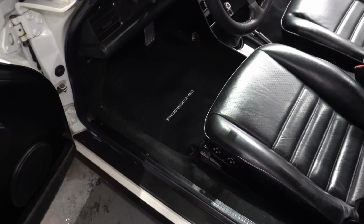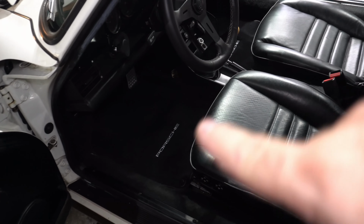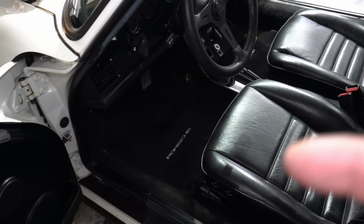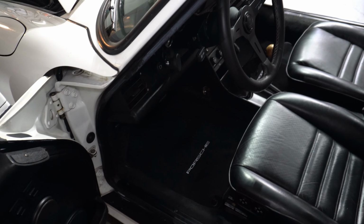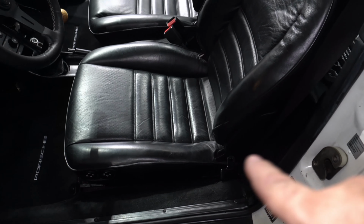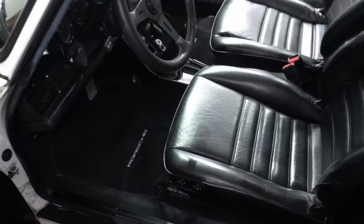And that'll do it. So just to recap, just try and loosen the front two. See if you can get the bracket underneath. Don't let the bottom square bracket or the nut fall out. Loosen the fronts. If you can bend it up a little bit, get the floor bracket in, then tighten it back up. If not, then come back here. There's two in the back, 6 millimeter. Just loosen those maybe a turn, and then see if you can get it in. And that will make the install go from 20 minutes to, because of my foolishness, to maybe 10 minutes.